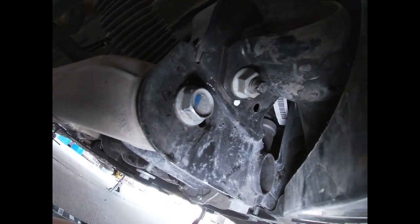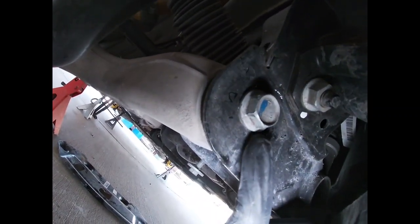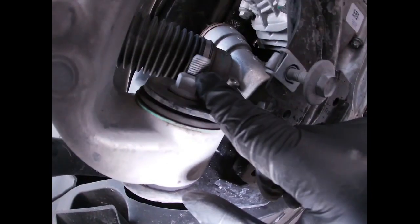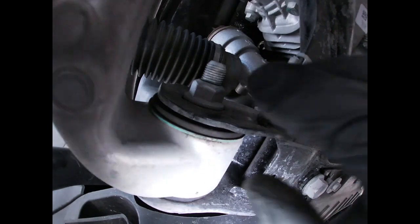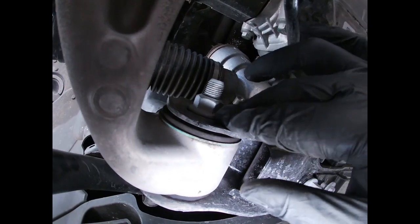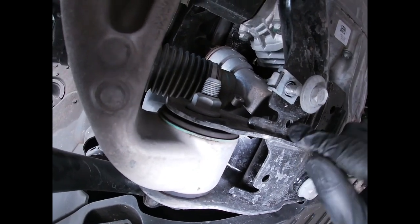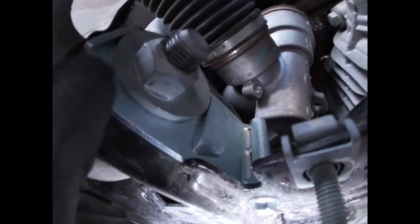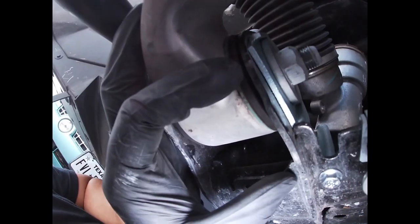I'll show you guys right here. This is the bolt, and it pretty much lines up where it was originally. So those are things that you have to look for, especially whenever you're doing any type of alignment job. I'm going to loosen up this nut — this bolt's going to stay in there. Then I'm going to install the little plate, then install the screw through this hole. The camber is installed. There you can see where the washer — you can move this part back and forth like that.